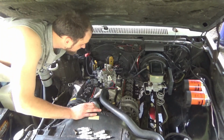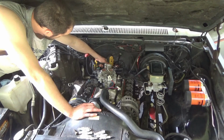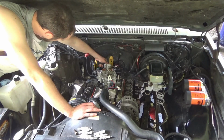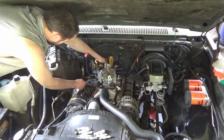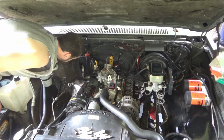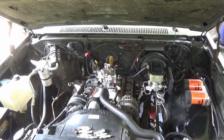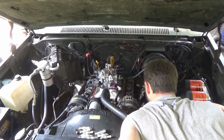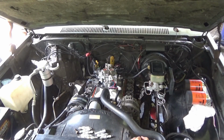There's the relay box on these things. I don't know. So it seems to be working right. We're leaking good off this end here, so we got oil in the filters. Yeah, I'd say we're primed. Pretty much just do it till it comes out the rockers, and the rockers are pretty much full now. So let it sit for a little bit and drain back out, and I'll Teflon those before we fire it, just so we don't have more of a mess.